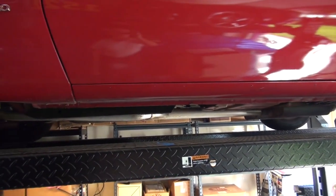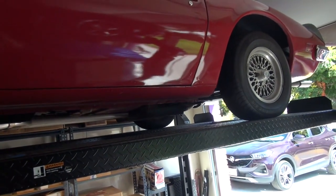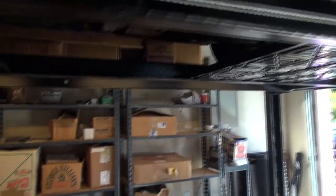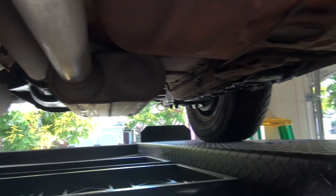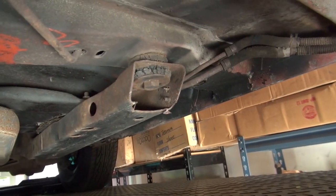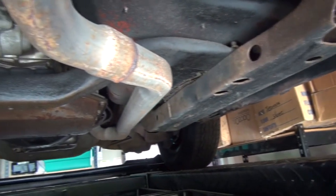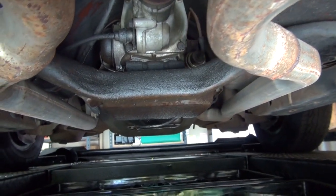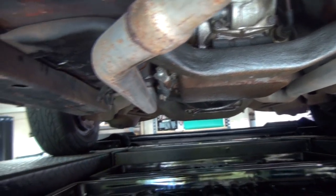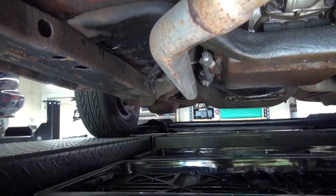Here's the before video of my 1970 Firebird that's going into the fabricator tomorrow. It has a 350 two-barrel with dual exhaust. Here are examples of some of the worn-out frame bushings. The standard three-speed automatic is going to be replaced with a 6L80E six-speed automatic transmission, as well as a 525-horsepower LS3 376-cubic-inch engine.